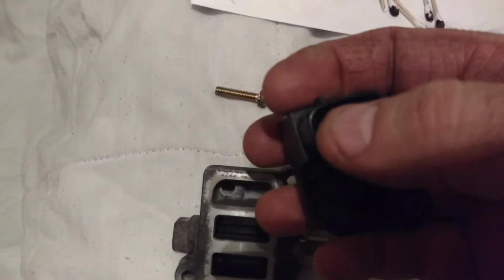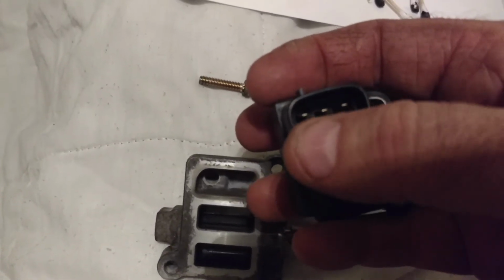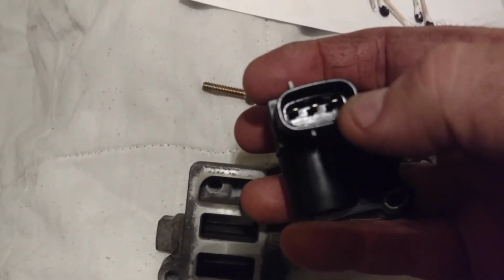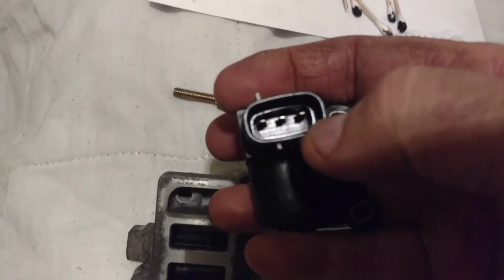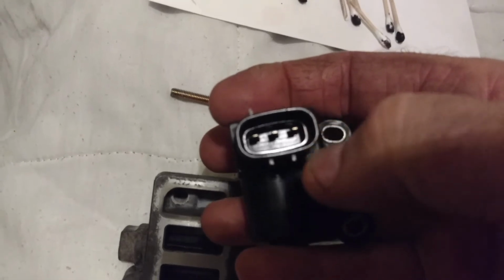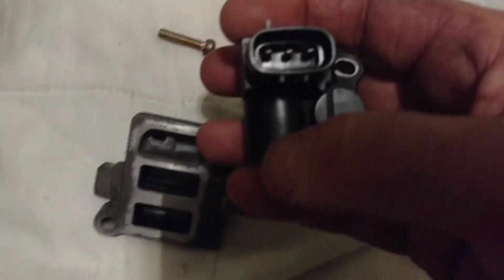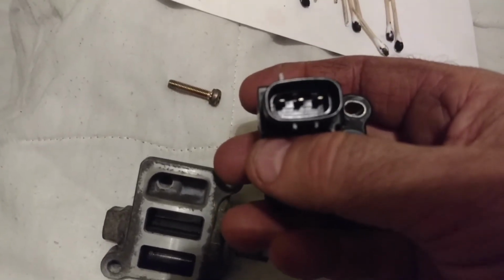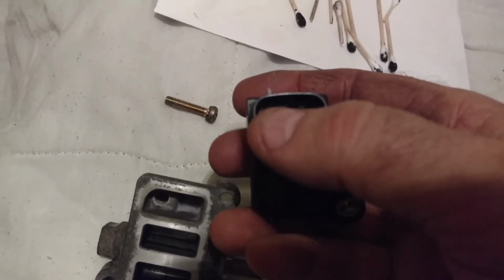If you put your ohm meter on these leads, the digital ohm meter usually reads high megaohms. It's because there's some diodes in series with that. So if you switch it over to the diode scale, depending on how you position it, there's some classic 0.6 volts or so measured, indicating the diodes in the circuit. Diodes are sometimes used to suppress voltage spikes when you turn on and off voltage to a coil.